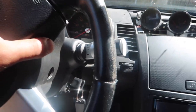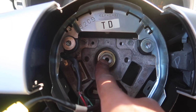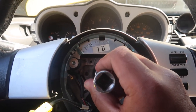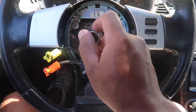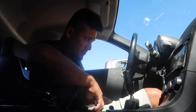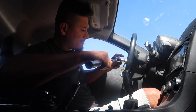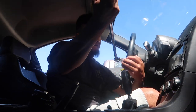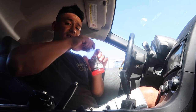The airbag pops off just like so — now we are free of the airbag, so I'm gonna set this aside. Next, what we're gonna do is remove this 19 millimeter bolt right here. Get our breaker bar and break this thing loose. Once that is done we will be able to remove the steering wheel completely, and be that much closer to installing the NRG hub, quick release, and steering wheel. Turn the key — that wasn't tight at all, actually, I got it loose pretty fast.